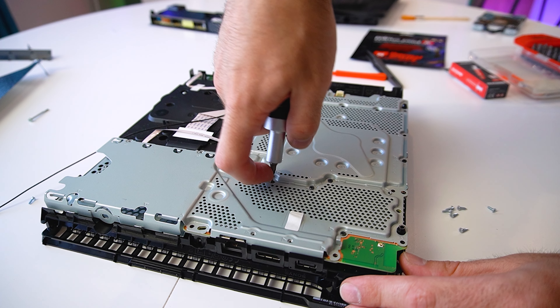And finally the most important bit — reapplying the APU's thermal paste. Normally a pea-sized dot should be enough, but to ensure an even contact surface, you can spread the thermal paste.